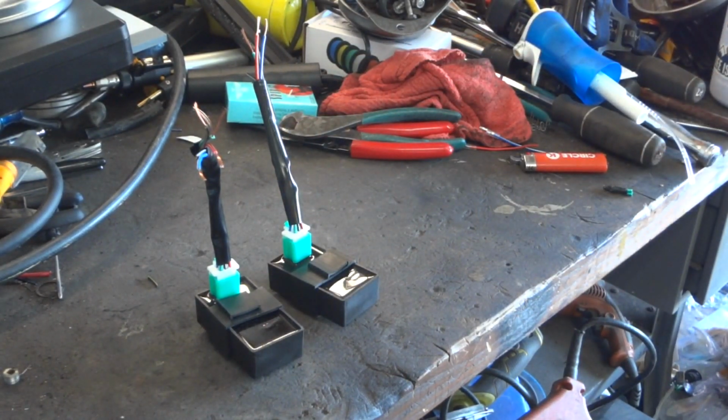My idea, obviously I've used this technique for single cylinders and 2-cylinder engines that have the lost spark in them, meaning that both cylinders fire at the same time, whether or not the one cylinder is in compression stroke or the exhaust stroke, it doesn't matter. And I think it'll work.